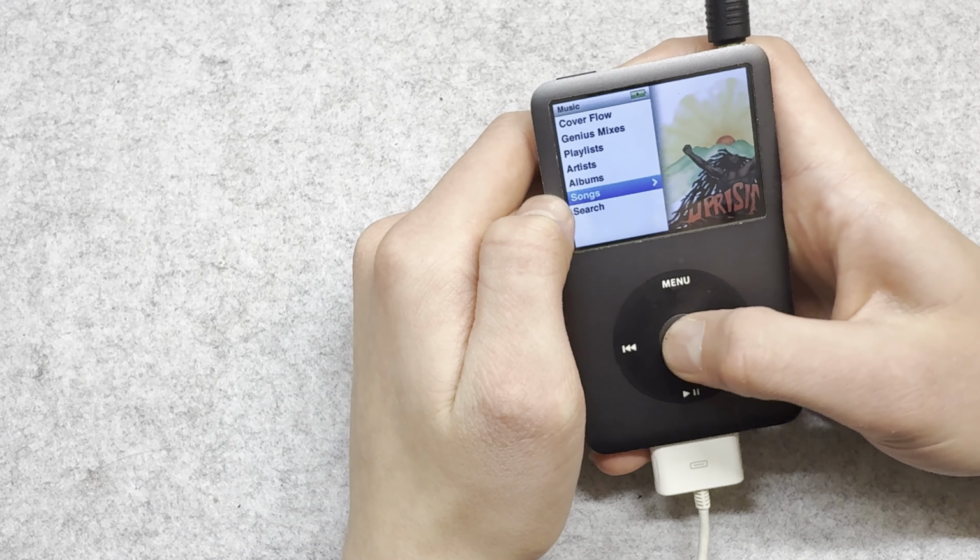Let's take a look at the drive health here. Okay, it looks okay. So we got some reallocated sectors. Only 269 power on hours, but a huge amount of start stops. Retracts doesn't matter. Pending sector is 0.